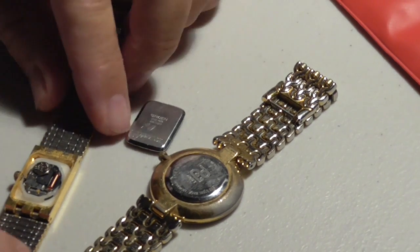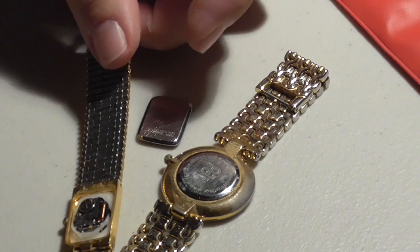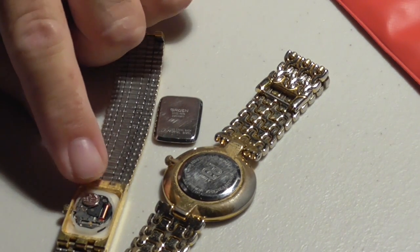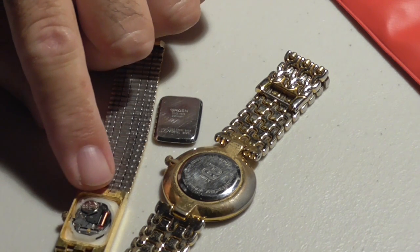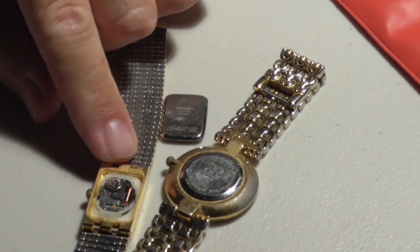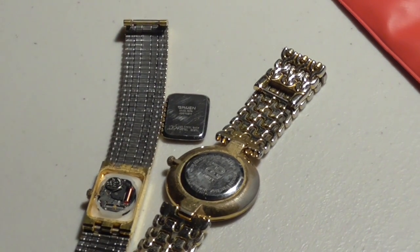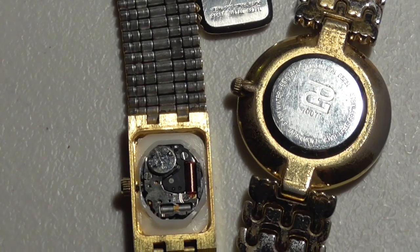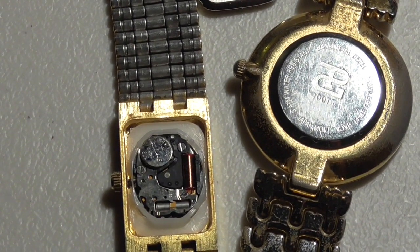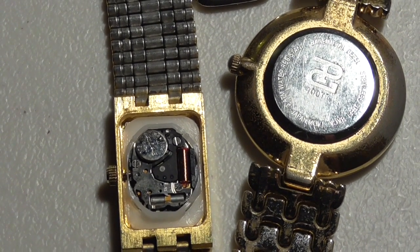You can see there is a battery in there, and you have to look to see what's holding the battery. Sometimes it is just a spring fit, and other times it's held down with a bracket and you have to remove the screw. So look and see what you need to do. You can see it's just being held in by a little spring clip, so I'll pop that battery out, put a new one in, and I should be able to put the cover back on.